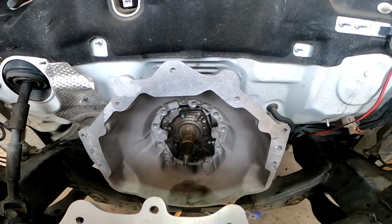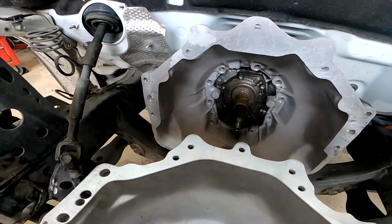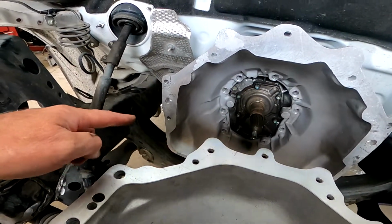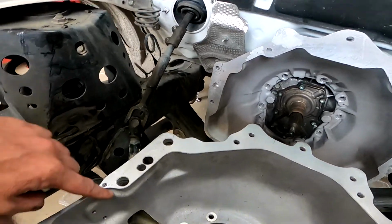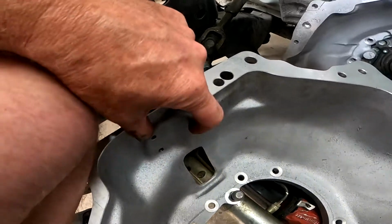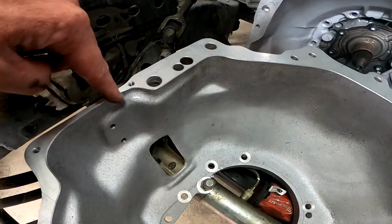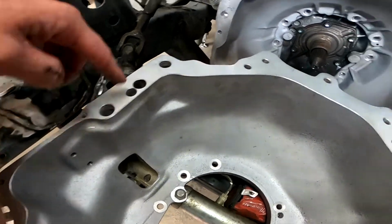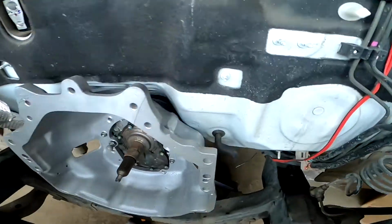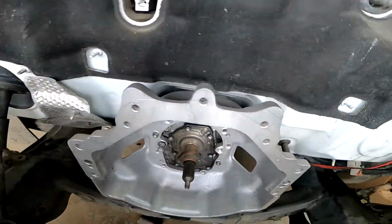Okay. What's the starter issue? The bulge. This one here, the bulge is too low. It's not low enough. So this one, you can see the starter pinion engages up in here, and it can be the other side as well. But I've cast this high, so right up here, where this one would need to cast right up through here. No. Your pointy stick's gone. Yeah, it's tight. It's tight.